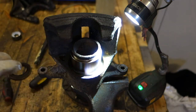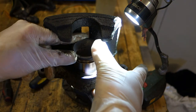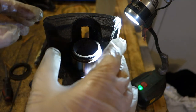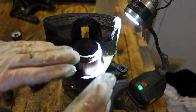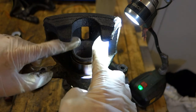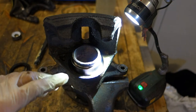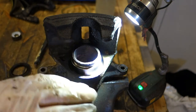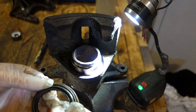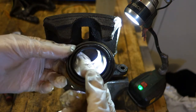And this is, for a novice, the most difficult thing, because now there is compression, this inner gasket takes back and it resists, and that's why we need to press that in very steady and stable in the same direction. Then it goes nicely when we press in these points with a little bit of movement, and then we stop. Remember, not to the end, like in half, because we need to insert that gasket next, and this gasket goes in not in that way, it is like in an upper way.